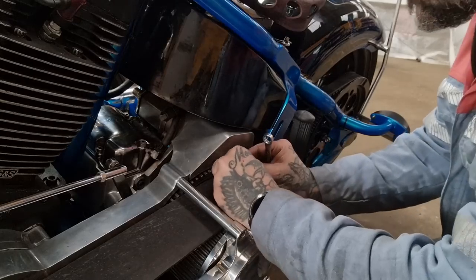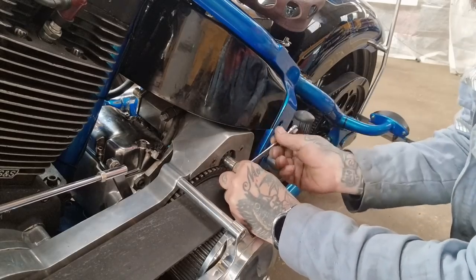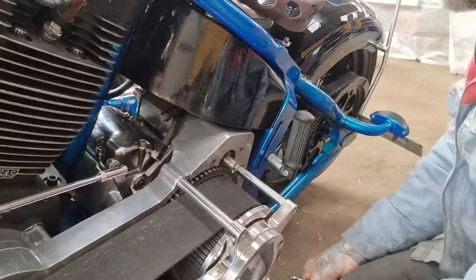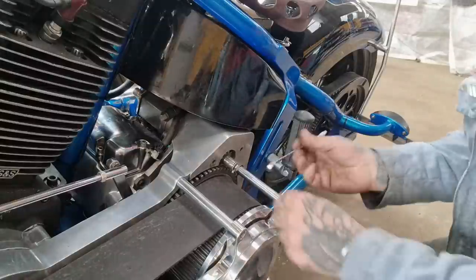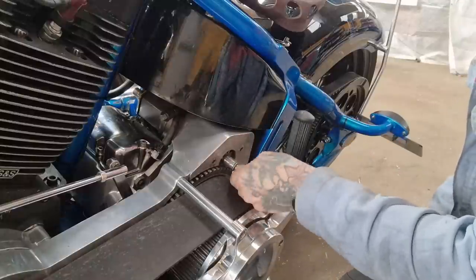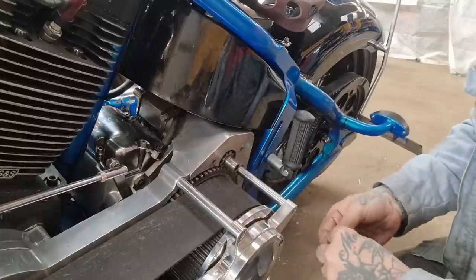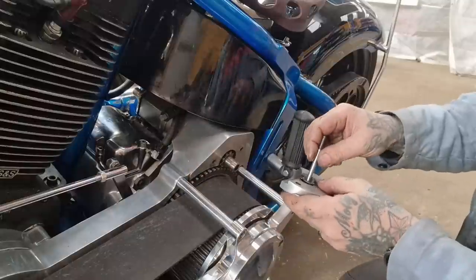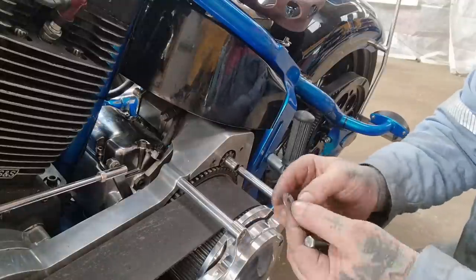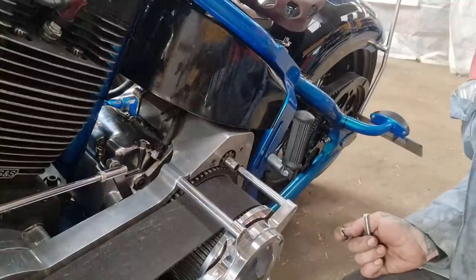Get that back in the slot — still a bit tight, but I've got the right spanner now. This should just wind in. I'm hoping that this tab washer fits into that bearing. It might end up with Loctite on it because that ain't going to work — there's a bearing goes on the end of this shaft and the tab washer's got to fit in a bushing in the end, and it won't. We have reworked that washer to make it smaller.